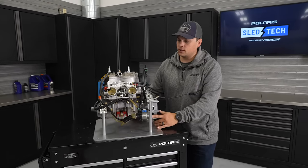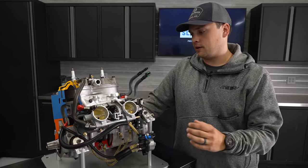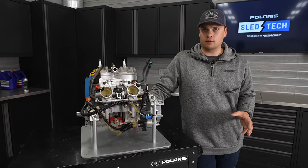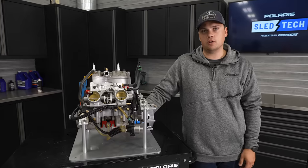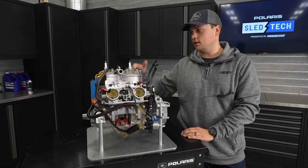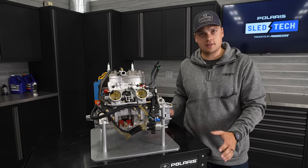On the intake side: the 50 millimeter throttle body like we talked about, and then V-Force reed — a really high quality engine reed — sticking with V-Force that we had on the clean fire, with more durability in the injection system as well. When we started the Patriot platform program back in 2014 and launched it in 2019, it wasn't just 850 written on the whiteboard. The intention was always to build a really strong, solid platform and then build our engine variants from it. The engine is ready for boost — the boost application gets an extra set of injectors, a different set of pistons, and a big turbocharger. It was built for boost.